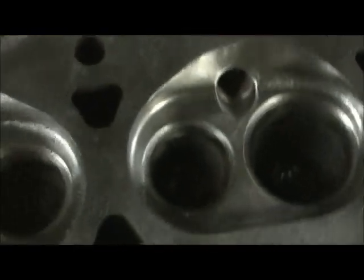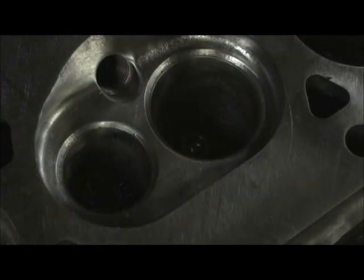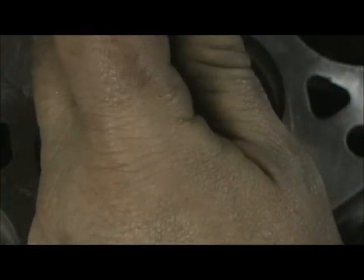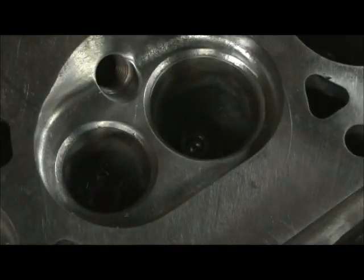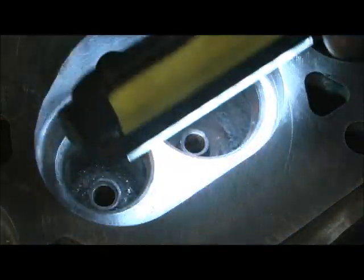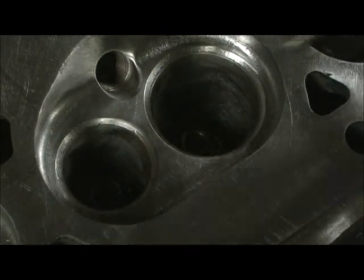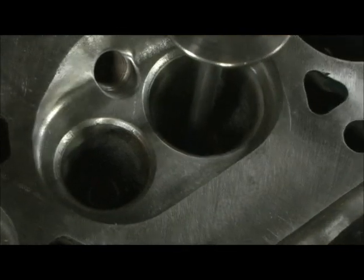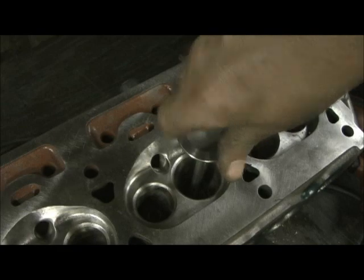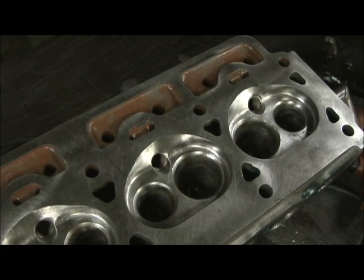This right here is a pickle, I mean to tell you. You have to set it right on exactly — if you don't get it exact... That's supposed to be sized exactly. Now watch — one thousandths undersized. Now look here. Still won't go through all the way. Done once again intentionally for the hone. Let's go ahead and break the hone out and get a pass and let me show you how I do.